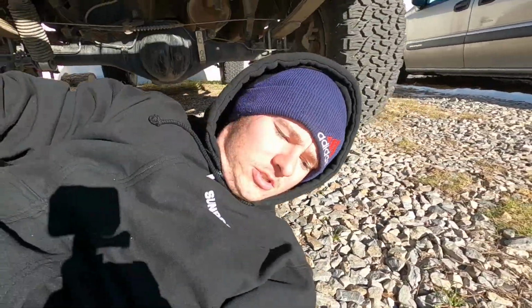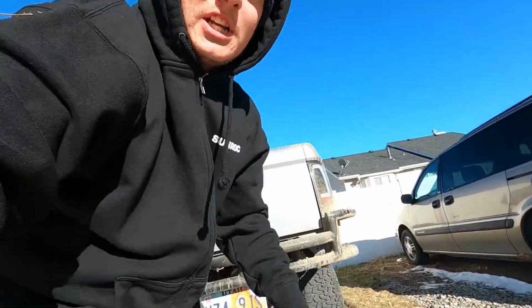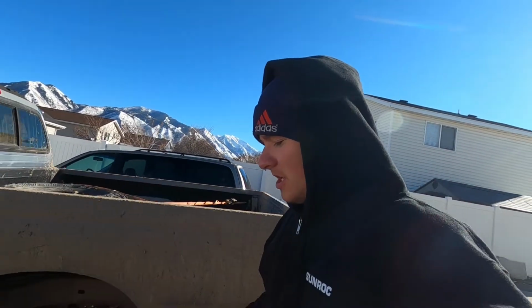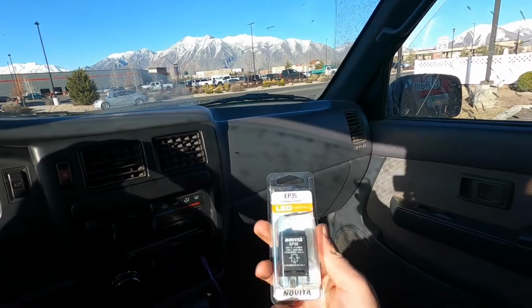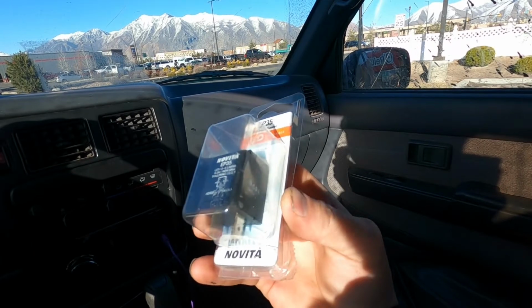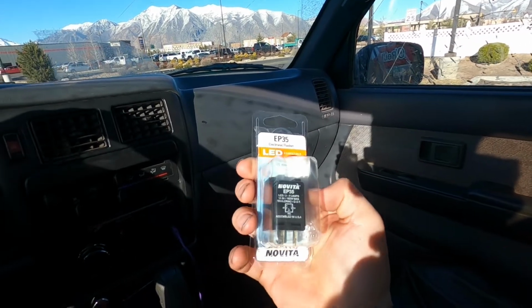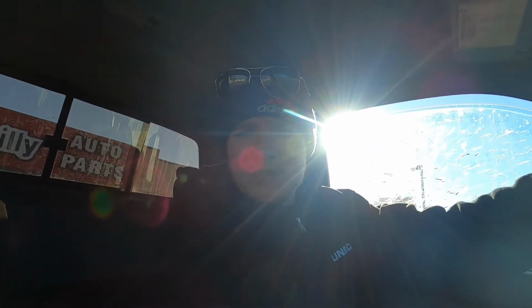So we're gonna get up, and it still hyper flashes like you said. So we're gonna go over to O'Reilly's and get me an LED flasher, and that should fix the problem. So let's pop over to O'Reilly's and get some more truck parts. All right, well, ladies and gentlemen, we now have gotten our EP35 LED flasher. Should be an easy fix to get this hyper flash fixed. So let's head over to Tanner's house and throw it in.